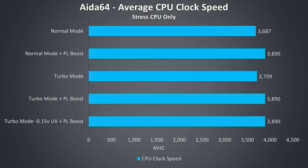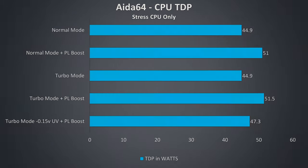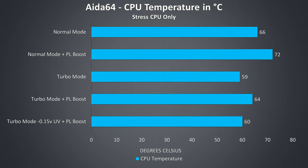These are the average CPU clock speeds while under a CPU-only workload. With Aida64 and just the stress CPU option checked, I could only hit the full 3.9GHz all-core turbo boost speed of the 8750H once the power limit was manually raised. In a CPU-only stress test I found both normal and turbo mode would cap out at 45 watts, but by raising the power limit this workload needed around 51 watts to achieve full performance. It's worth noting that I couldn't raise the power limit with Intel XTU for combined CPU and GPU loads — only for CPU-only load. Raising the power limit does result in increased temperatures, as more power equals more heat, though these were also lowered in turbo mode due to the increased fan speed, and the additional undervolting helped improve this further.